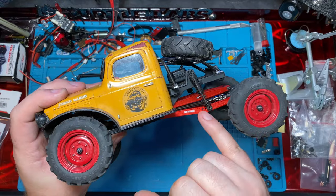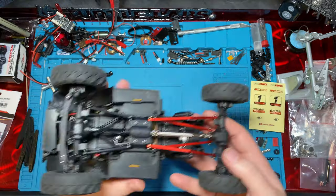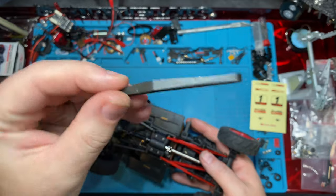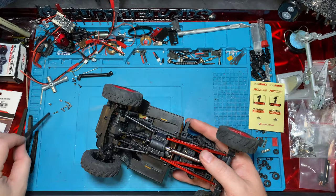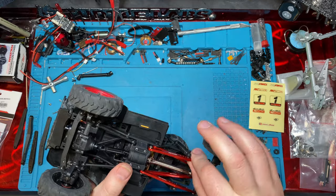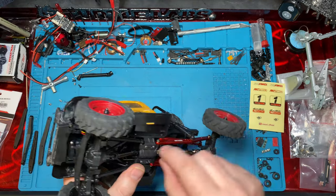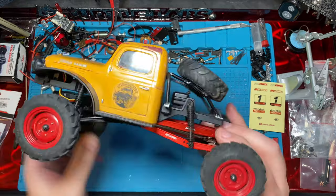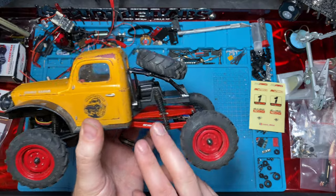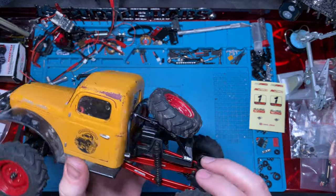It's nice that it's got multiple shock adjustment spots for sure. It's nice that they're aluminum. They are thin, although I do like the kind of beefy look of the McHugh's — they look nice and thick and they definitely fit the look of the truck. But being aluminum, they don't really need to be thick. You'd rather have less weight — you want your weight on your axles, not on your links or your body or your chassis. You want the weight on the axles as much as possible.